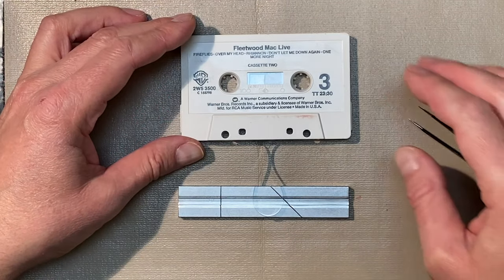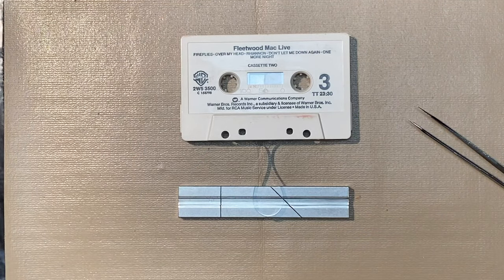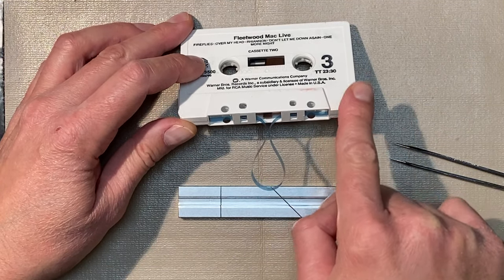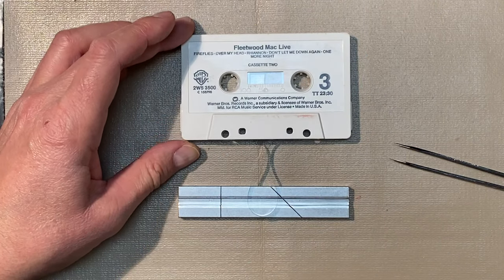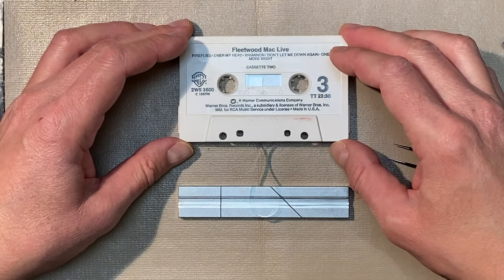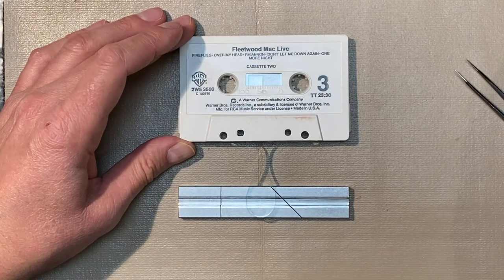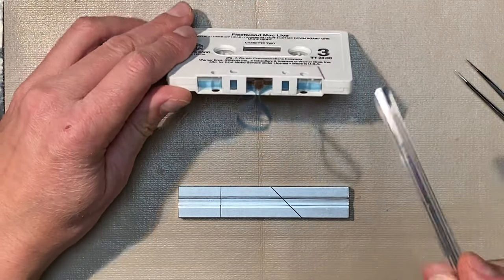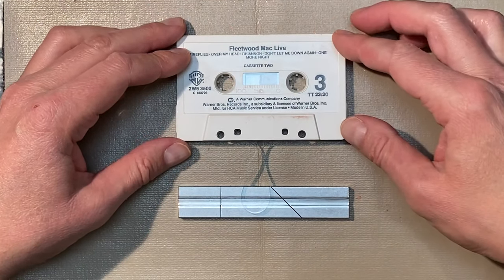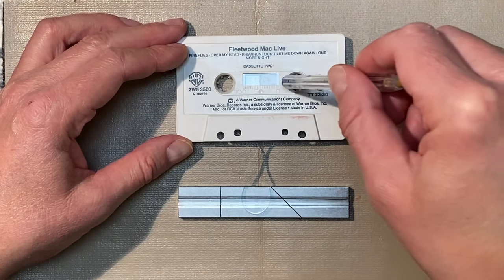And that would be true as well if it had split somewhere in the middle of the cassette. Say it's a 45-minute or 30-minute cassette and it broke at minute 15. If you were able to, and you had both sides of the tape available, or if you were somehow able to spool it so that the tape came out, then you wouldn't have to do this. In the great majority of cases, though, that's just not going to happen. One side of the tape is going to be stuck inside, and there's really going to be no way that you can, even if you reverse spool this, get the tape to come through this notch. So no, you won't always have to cut apart the cassette shell or open it up, but in the great majority of cases you will. Okay, so just a quick note on that.